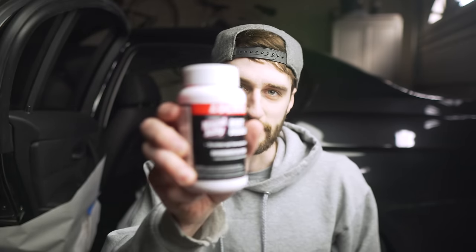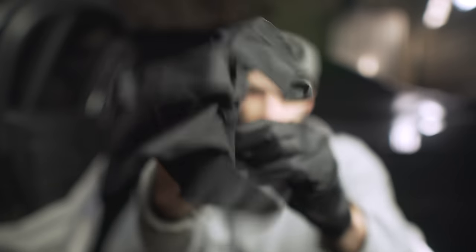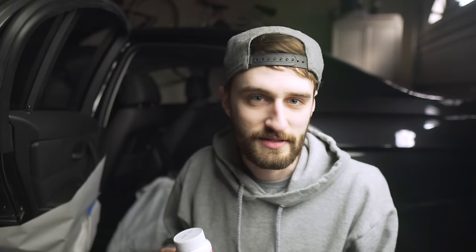After the sanding is done we got all the paint off that area down to bare metal. We're going to use something called Naval Jelly — this is a chemical rust remover — to be absolutely sure all the rust and oxidation is gone before we start painting. Just so you know, this stuff is kind of harsh, so make sure you're wearing gloves. It will also damage paint, which is why it's really important to mask everything off. You basically put it on, let it sit for 10 minutes, and then rinse it off with water.